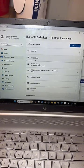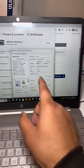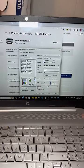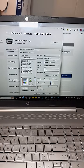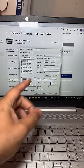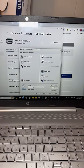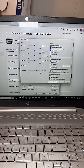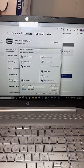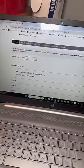Click on it, then go to printing preferences — and yours should look like this. If it does not look like this, then either your driver wasn't downloaded properly, or go back to printers and scanners and see if you see another 8550. When you go to printing preferences, you want it to look just like this. Then go to maintenance, click the picture extended settings, uncheck the first two boxes, and make sure the third and fourth are checked. Then hit okay, hit okay. That's all we need to do from a driver standpoint.